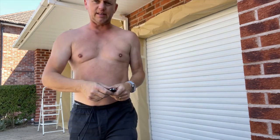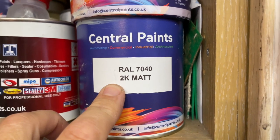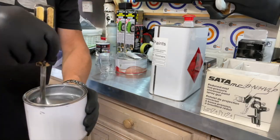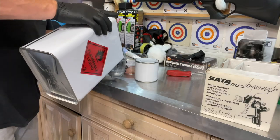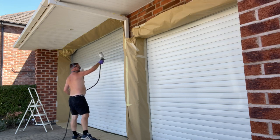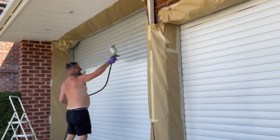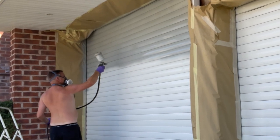This is the paint we're using — it's the RAL 7040 2K matte, the elephant grey. We've got to mix this up to get a nice consistent blend. It's got paint thinners and hardener in there. I'm using the SATA HVLP low-pressure gun — it runs at about 43 PSI. Nice hopper full of paint, and I'm just going to slowly work that across. It's going to take two coats I think, the way it's going on.